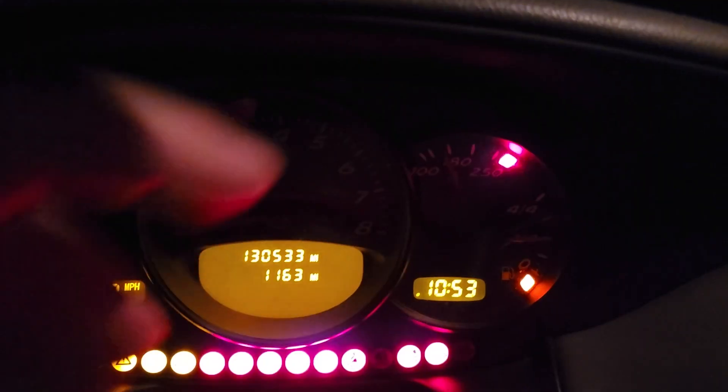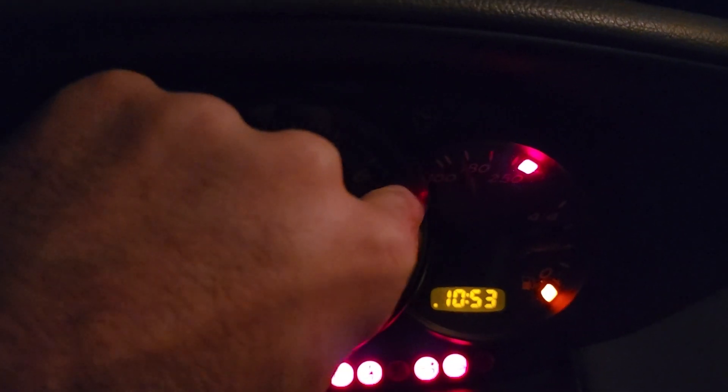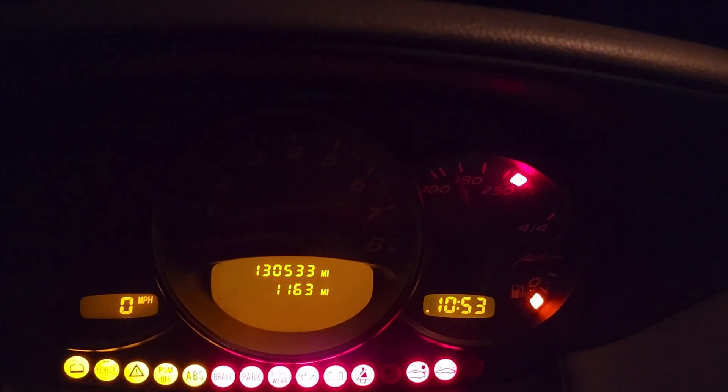I drove the car for a little over 20 minutes and what I think is that the temperature got to a certain point and then the car just told me it's not going to read the temperature anymore. This light right here right above the temperature gauge started flashing on me and the temp actually went all the way to the left. So I was concerned, pulled over, stopped, turned the car off, and then it wouldn't start. I'm going to try it one more time just to show you that it won't start. Yeah, it's turning over but it won't start. I did a little bit of digging on this while sitting here waiting in the car for my wife to come pick me up, and if I'm right this video is going to show me replacing the crankshaft position sensor.